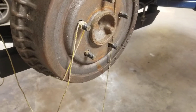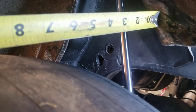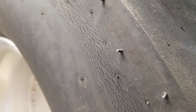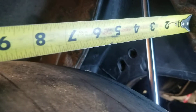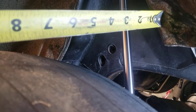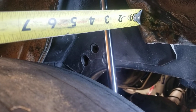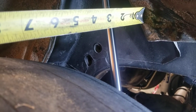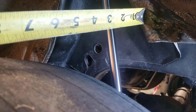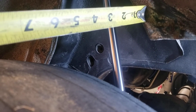Knowing how much I want for clearance on the back side — about five-eighths of an inch of backspacing clearance from the back of the tire to the inner fender lip — I can add how much clearance I've got total on both sides. In this case approximately two and a quarter inches on both sides gives four and a half inches total, and I wanted to take off five-eighths off both sides, that'd be an inch and a quarter. So I'm going to be yanking off between three and three and a half inches.